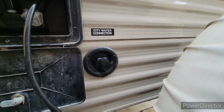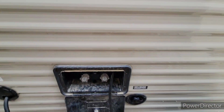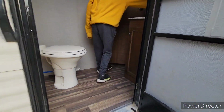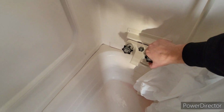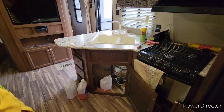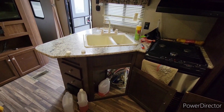We are pretty much done. Now what I also do, since I'm done, I crack all of my faucets open a bit. Caleb, go open up all the faucets. Just about a quarter of a turn. You missed the bathroom tub already. It's okay, I'll get that one. The other thing is make sure you wipe up all this antifreeze because it will stain. That's fine. So, now Caleb, what we're going to do is... Okay, now we're going to pause it.